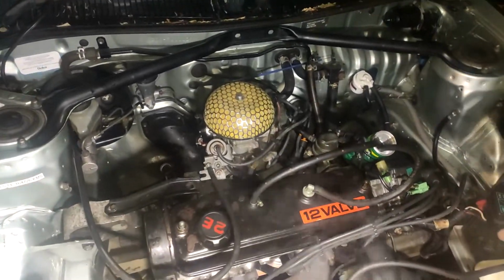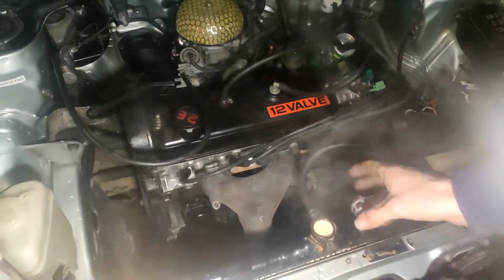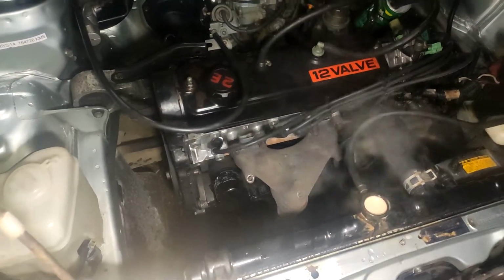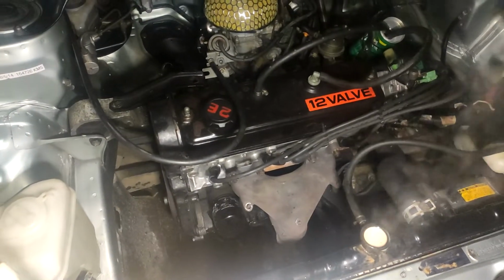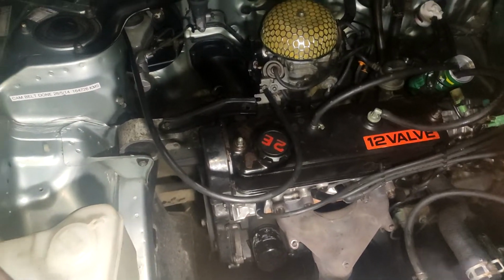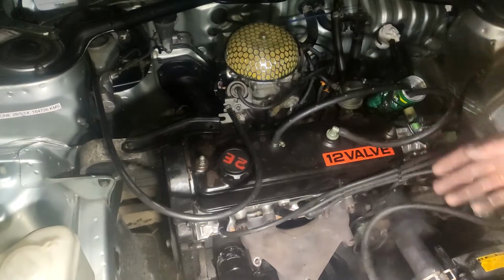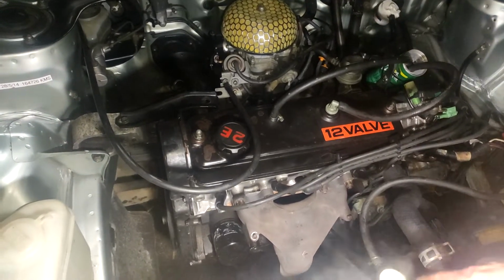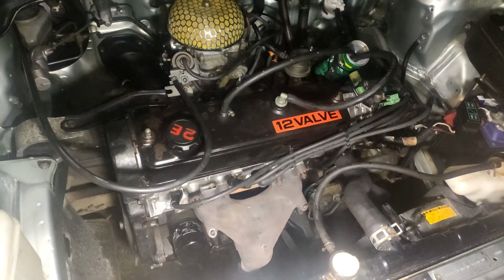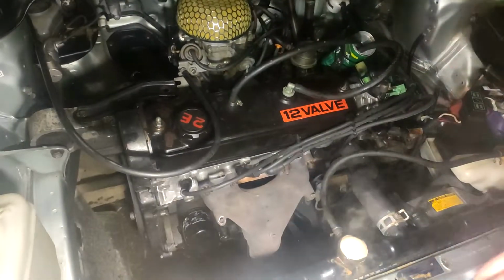So we're back here. We've got the 266 cam in here. I'm just letting all the bubbles out of the radiator and everything. It's still running, man. It's at 15 degrees of timing so far. I need to go over the valve lashes, but I'm letting the warm-up and everything bleed. I've got the heater core on, so it bleeds the whole thing.